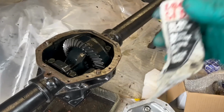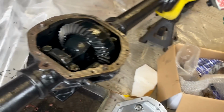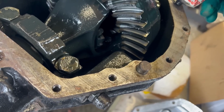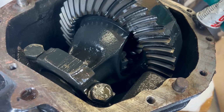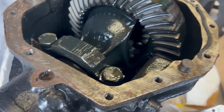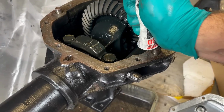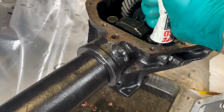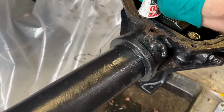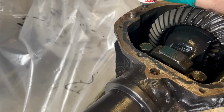Got some black silicone Loctite 5980. I'm not sure with the paper gasket whether you need this or whether you just wipe oil on it and then clip it on, same as a motorbike side cover or something. But we are putting the finest of beads on here just to help it a bit. I say finest of beads, this is an old tube and the nozzle was all gummed up, so I'm just doing the inside, not doing around the outside of the bolt holes because they should be okay. And I'll smooth all this out with the razor blade in a minute anyway, so we don't get big gloops. You get the idea.